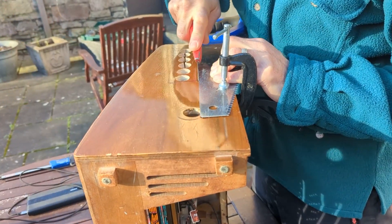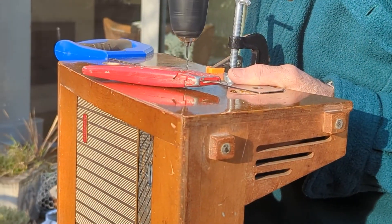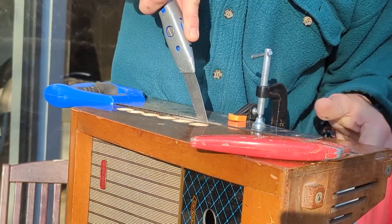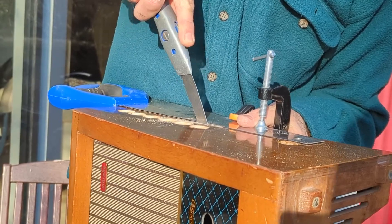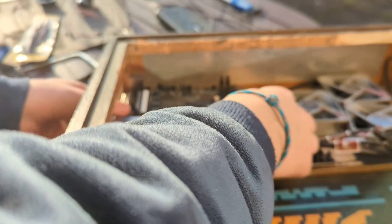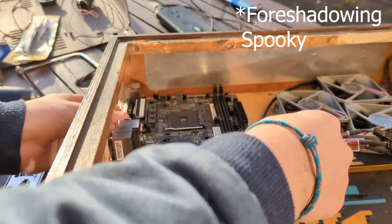So that's what we did. You can see him marking out the IO shield with a box cutter, then drilling holes at the corners so that we can fit the saw blade in to cut it out. We used a regular saw as a straight edge, but unfortunately it wasn't actually straight as the top of the radio isn't straight, so excuse the slightly uneven edge. Repeating that same action four times for all four corners, we now have an IO shield. Testing it with the final motherboard, it fit great — like a glove. Some of the standoffs didn't quite line up, but I'm sure I'll fix that in the future.